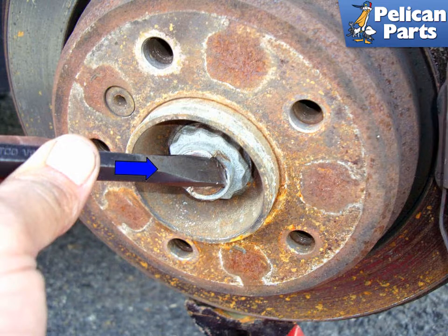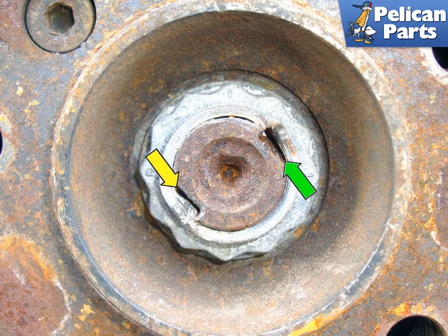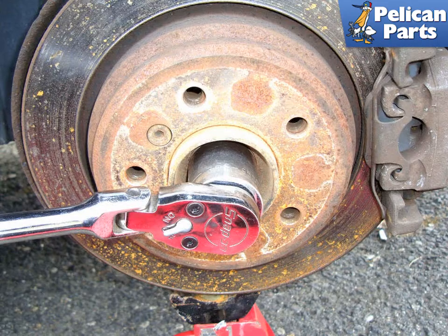You need to be wearing eye protection when you're working on your vehicle. Here you can see the top right pinch has been tapped away and the lower left still needs to be moved some more. Use a 36mm 12-point socket and remove the axle nut in a counter clockwise direction — it is on there tight. If you have an impact driver, it's best to use that.